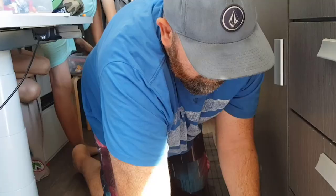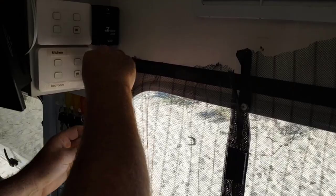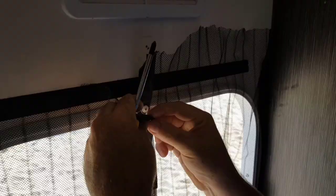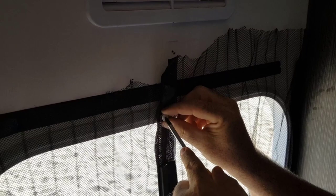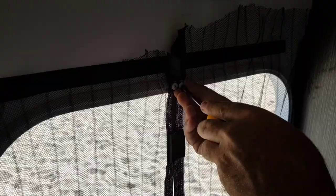I'm going to line the entire side instead of individual sections, then pop it up on the door. I'm just lining this up in the middle — putting that one through here to help me get my line up — and then making this a little bit loose on the inside so that my velcro lines up with the old velcro I had previously. I'm just going to trim that around and as you can see in the middle it starts to line up. I'm putting this little screw in to help keep them centered — I didn't have these originally but it stops the door getting pulled downwards or riding upwards. So just a little washer and then a little 12mm screw, and once these are screwed in it keeps them tight in this one position.